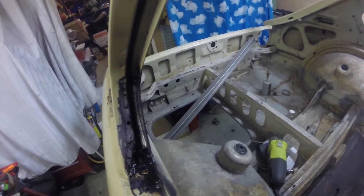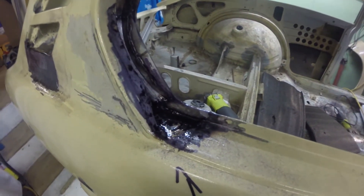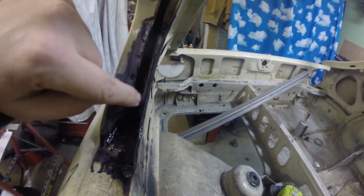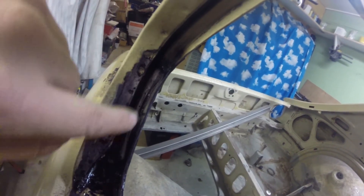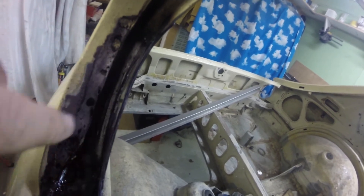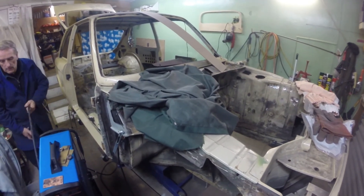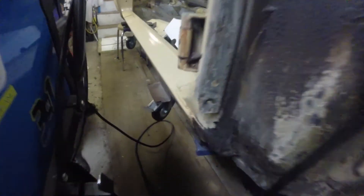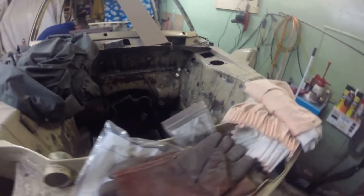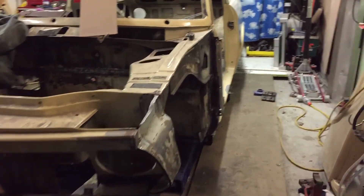There we have it - the new corner all in and just coated in epoxy to stop it from rusting. Essentially it was four pieces: one piece that went up the back, this inner channel piece with a bead-rolled edge formed in it, this big outer piece that went on the back, and a little fillet piece to get that shape right. So we've got that perfect window shape - nice. We've got a car coming in tomorrow night so we're going to test these little wheels on this frame and see if we can move this car into the garage for the weekend.